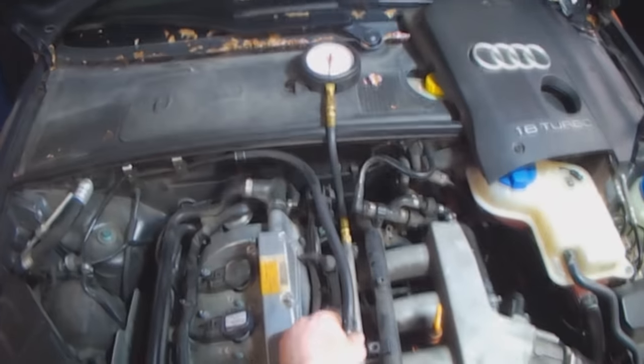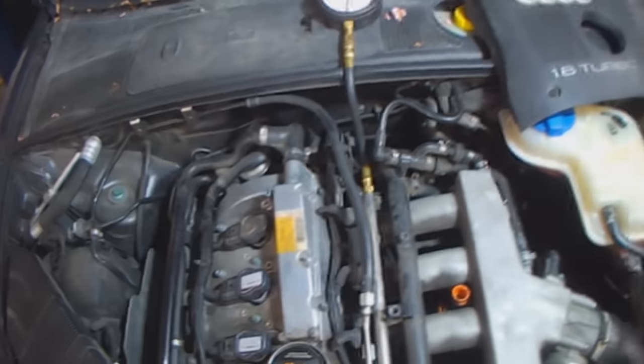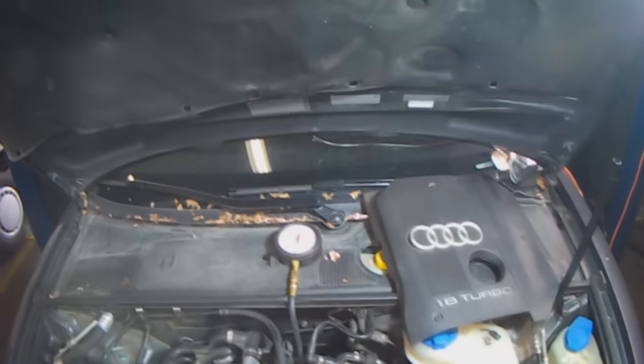Nothing exposed, that's tight. I also smell the oil for gas — I think you have a stuck injector. No pressure, lots of fumes, lots of gas. Well it doesn't really smell. Crank it — I want to see if pressure builds and if it drops.